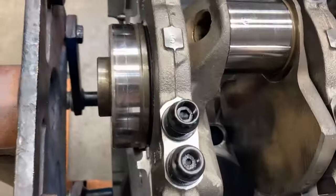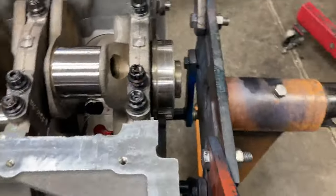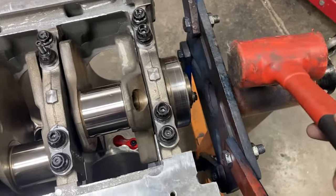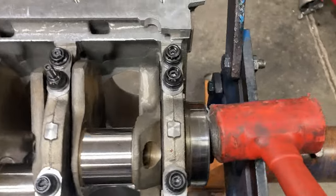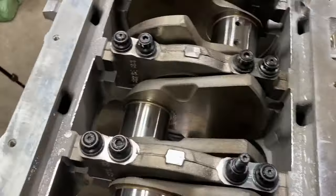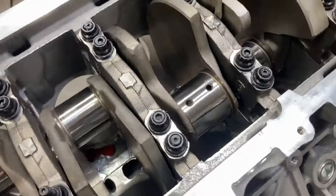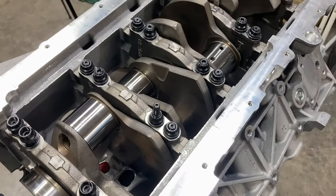The crank does a pretty decent job of lining up that cap, but I'm still going to give this a good whack to set the cap. First we drive it backwards — you always want to drive it backward. Then you want to make sure — I have to back the camera up so I can see where my hand is, because I don't want to hit a sharp edge. Give it a good lick forward, and then we'll wedge the crank forward using the counterweight and the cap. Then we'll torque everything down and check our clearance.